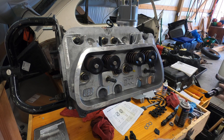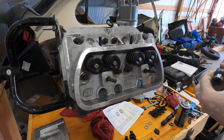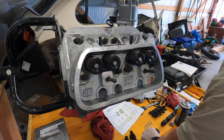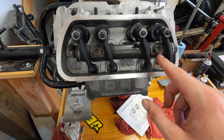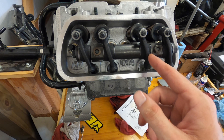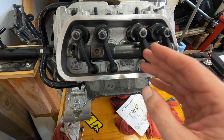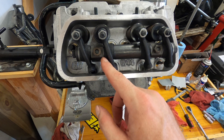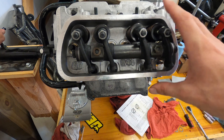I'm going to get an idea of what kind of shimming I need to use and go from there. This is another hardware situation for the one that's going in here — I've got to find the right hardware. The distance between the studs isn't going to change, so you've got to figure out where you can get those off-center a little bit while still landing properly to make it work. I've got one shim, a bigger shim on here, and a bigger shim on here — a little bit of a pain, but you've got to make sure it's off-center.